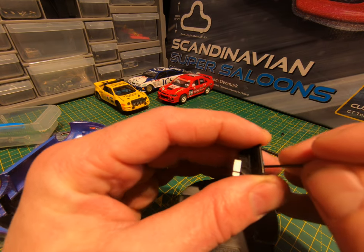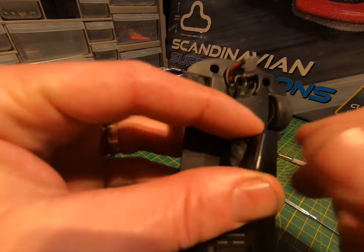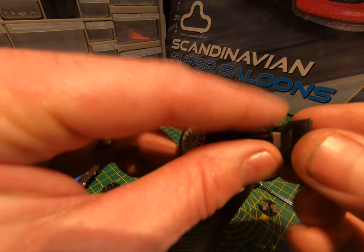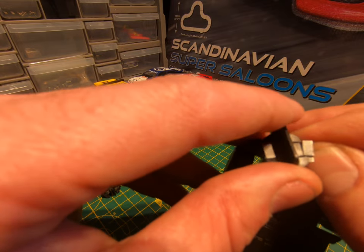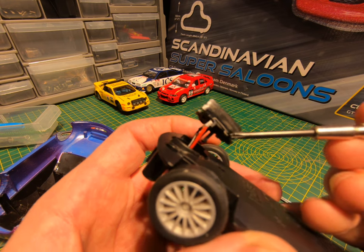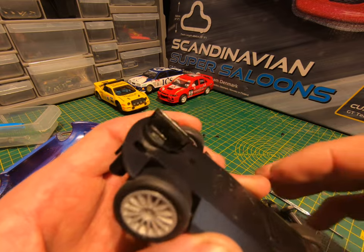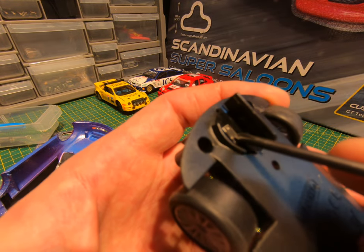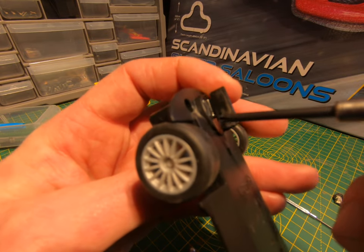Now get a little flat head and push them off to one side — there we go, they're off. Get your new blade — in this case it's the old one because it's not broken, for video purposes — and slide it back. Be careful not to bend it because then your plate won't spin properly. Get one side in, then the other side in. Make sure the longer opening is facing the back of the car, and simply just clip that back in.